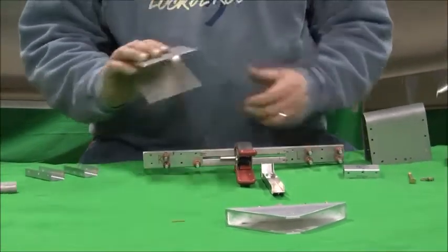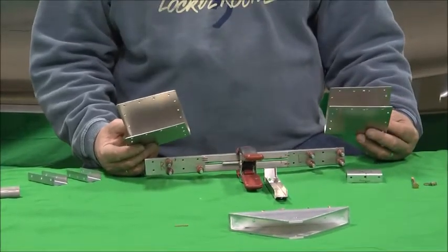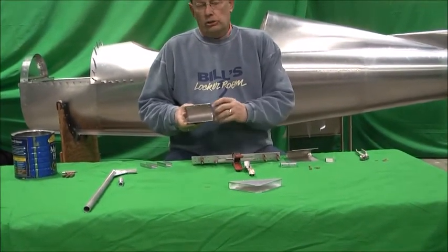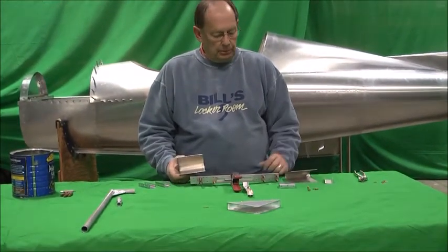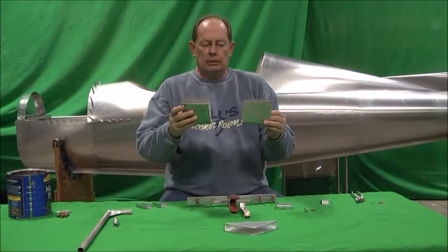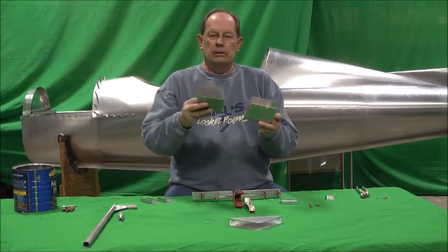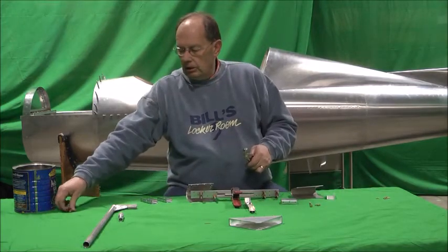Next thing I like to do is put the pedals on to get those in location. You can see there's an angle to them. You may prefer to build yours straight, however you like. This brings the pedal out about three inches from the pivot point. If you're long-legged, you can shorten this — you can certainly lengthen it, whatever works for you. We've found that this works for about everybody. We put a little angle on them more for comfort, so that when you're operating the rudder bar, it's more comfortable on your feet. We found that starting with them straight had a tendency for your feet to slide off when you went to push full rudder, so we came up with this little bit of an angle, and it's called out that way in your plans.